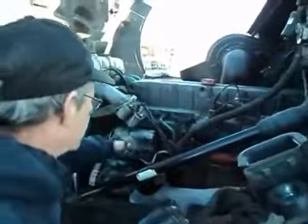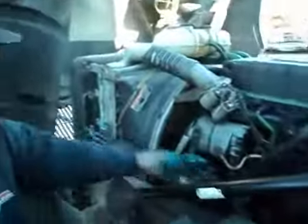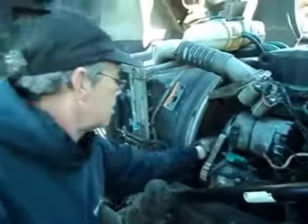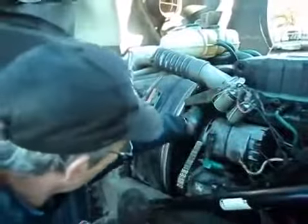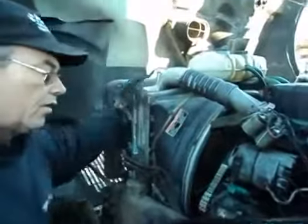This side of the engine: my wiring harness is all hooked up nicely and out of the way. My alternator and generator are secure. Belts are at proper tension. Fan blades — there's no cracks and none missing. Fan cowling is secure. Radiator is secure.